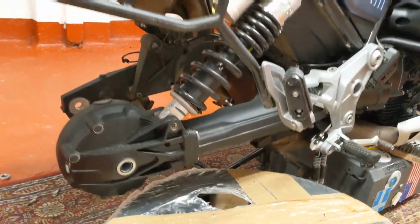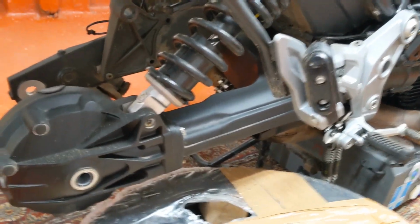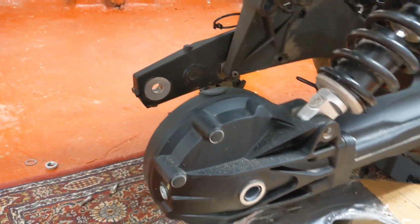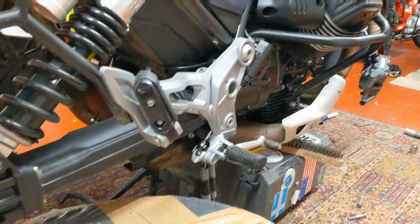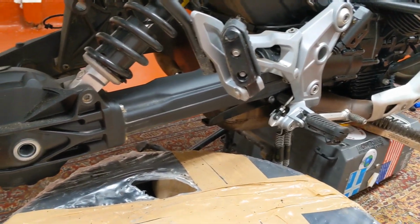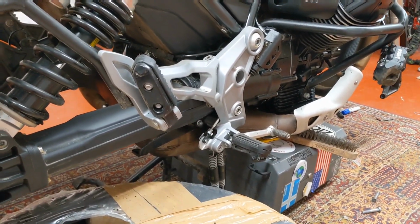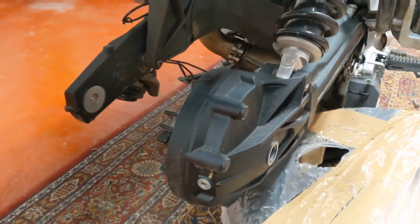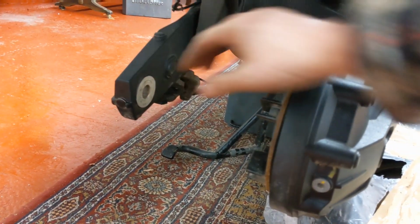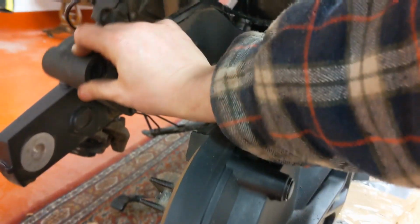And I think for any motorcyclist, simply knowing how to remove a wheel on that particular bike and knowing what exact tools you need is a real good asset. You know, just knowing that it's a 27mm on the rear and a 30 on the front, neither of which obviously come in the toolkit. So travelling with the right socket sets and spanners is crucial, whether you're going on a short trip or a big one. Just knowing that the best way to do this is to undo the caliper bolts, the rear brake caliper bolts, before you slide out the axle. That then allows you to rotate this sort of pivot here, if you can see that.